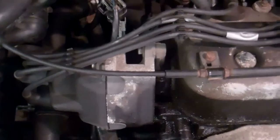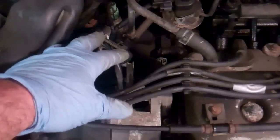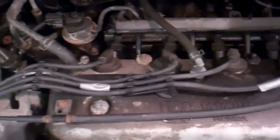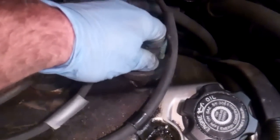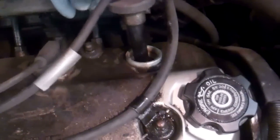As I say, reference the manual — this is how you disable the ignition system for this vehicle so it won't actually start while you're doing this. Then what we're going to do is remove the spark plugs. This one I already had off.